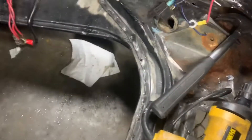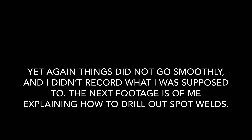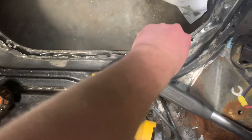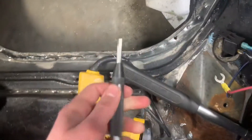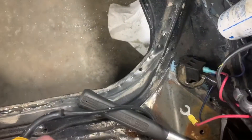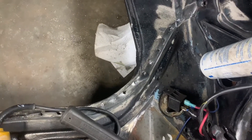This is the instrument we're using to take measurements before we replace anything. I switched to a special sheet metal drill bit. First you take this little metal punch that has a spring in it, push it down and it makes a bang and a little hole. Then I chased it with a small bit to widen it so that the special metal drill bit can come in — but it's only cutting through one layer of metal. Other than a small accident, it's been working a lot better than grinding, because I was damaging the first layer, which I do not want to do. So I switched to this method.